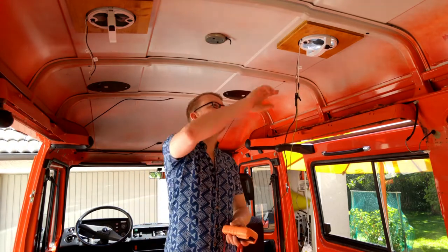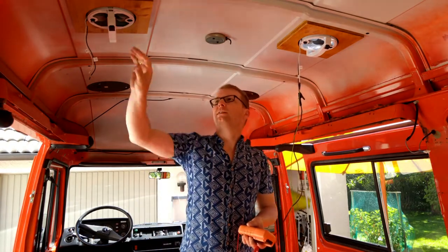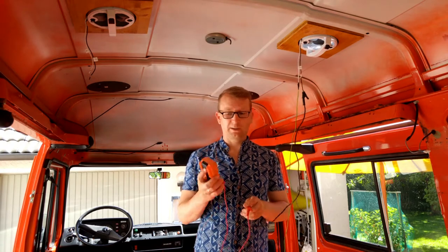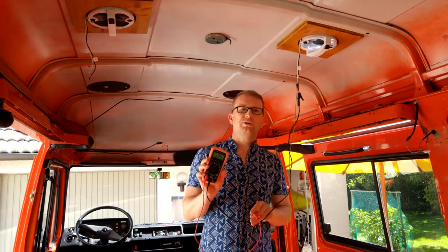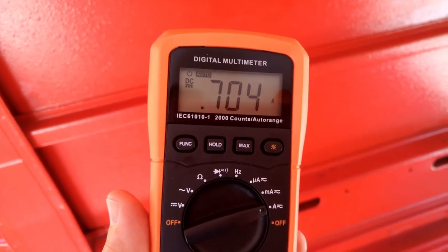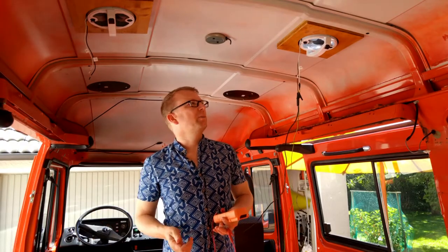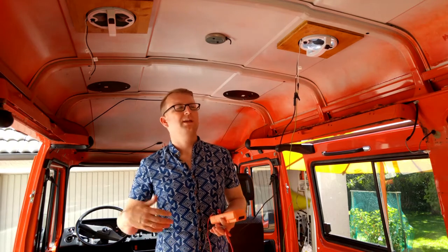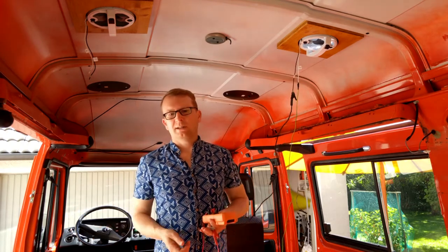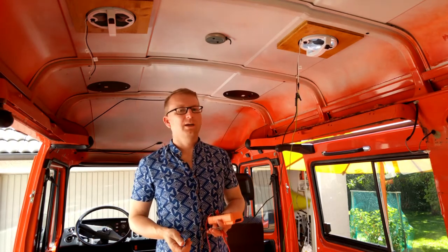In case I want to suck air into the van to get some circulation, that's easy: I activate one fan, then open the second one but do not activate it — and like this I have automatic airflow in on one side and out on the other. I promised to check the consumption, so I have my multimeter in hand — it consumes exactly 0.7 amps. That means in 24 hours you have 17 amp hours, which is considerable, but nobody runs it for 24 hours. If you run it 10 hours a day, that's 7 amp hours, which is completely okay with a normal-sized battery.